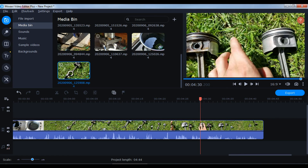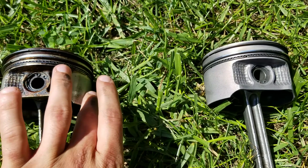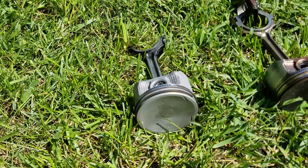I think the reason the piston felt rougher on the skirt is because Nissan pistons are coated with molybdenum on the skirts, and I think that may have reacted with the Simple Green. If you look at the piston before going in the hot tank it had a little bit of that black finish left, and now it doesn't — so I think it did react with it a little. This isn't really a concern because most of the parts I'll be hot tanking are steel, iron, or pure aluminum. Brand new pistons with molybdenum coating aren't going to be getting hot tanked because they're brand new. I'm not sure what that's about, but at least the steel came out really well and it definitely did a lot for cleanup.